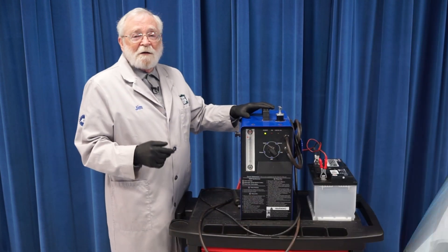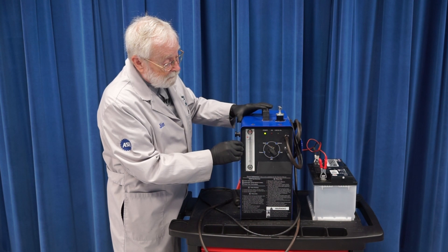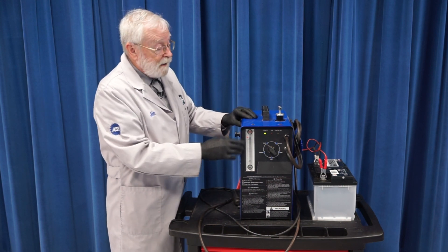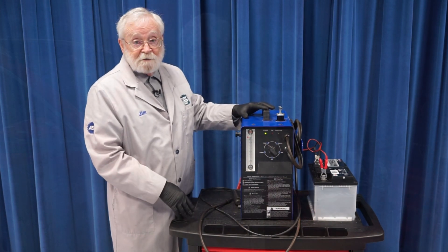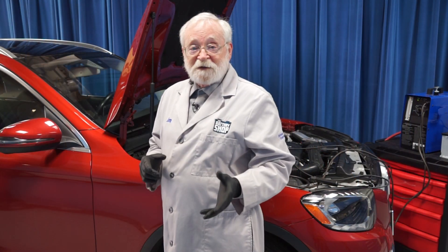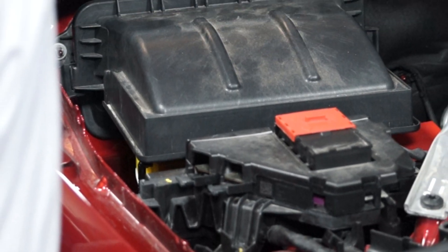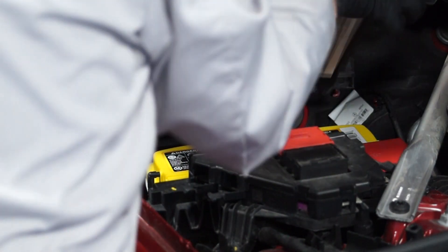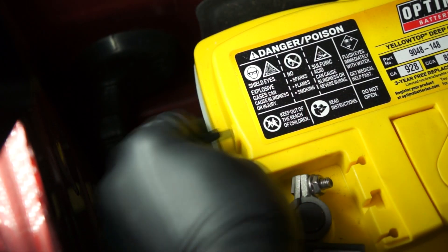Let's take a look at how we can do this. The battery's ventilation system is usually checked with a smoke generating machine like this. They utilize shop air and they're powered by 12 volts, usually connected to the battery of the vehicle being tested. The battery in this Mercedes is under the hood, but as you can see, it's right underneath the air intake for the cabin air. So we'll have to remove the cabin air filter and then carefully remove the vent tube from the side of the battery.